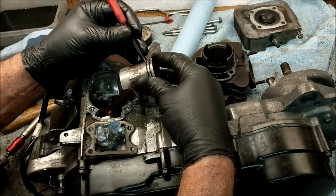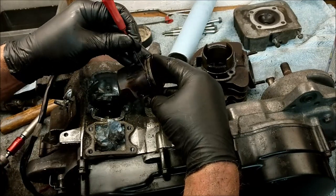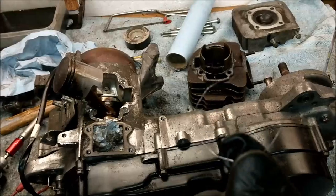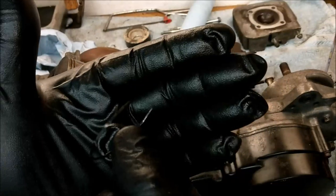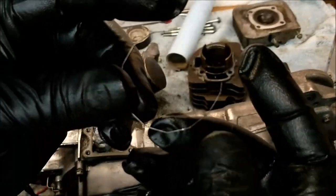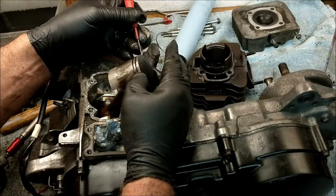Right, well, I think this is going to tell us a story. Like Max Bygraves, I want to tell you a story. Come on. Yeah, that says it all, boys, doesn't it? Guess where the rest of it's gone? Yeah. There. Part of that spring ring's snapped off and has been eaten by the engine, because I can't see it anywhere else in that channel.